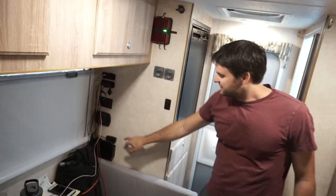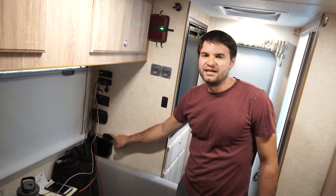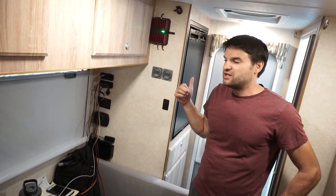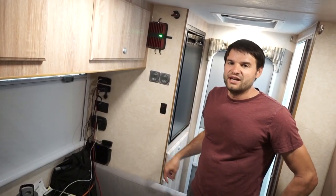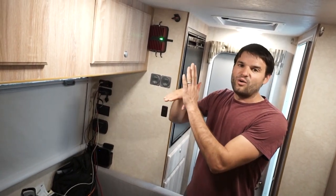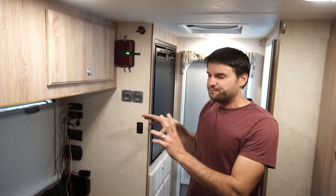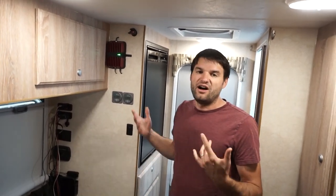Now on the inside, we have this little candy bar style antenna, and we also have our jetpack that then gets a signal off of that. Now what we found with a lot of testing and using a bunch of different apps to actually show the real gain that was happening from this unit was that your cell phone pretty much has to be touching that candy bar antenna for maximum effectiveness. And on my cell phone, it actually mattered if the antenna was at the top of the phone or mid or the bottom. It's pretty interesting how particular it was with that. So we put it in this spot so we could basically have both of our cell phones and the jetpack provide the maximum amount of boost all at the same time.